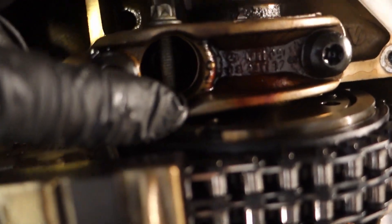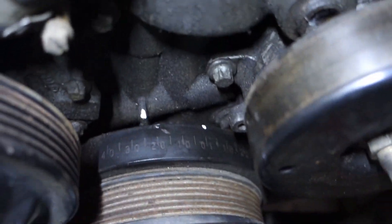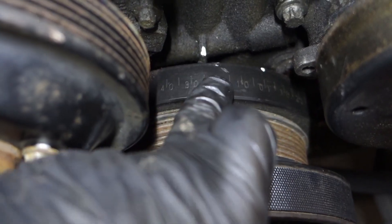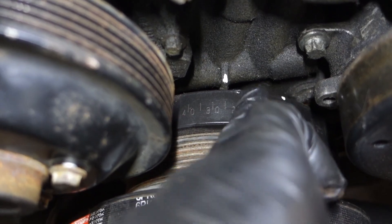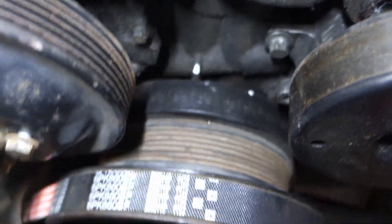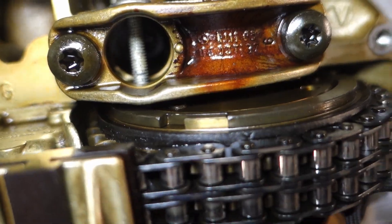As we can see, the camshaft is all the way retarded because this part is forward. Now we can see what crankshaft angle is — it's 25 degrees. That's completely fine; it can range from 20 to 30 degrees. If your timing chain and followers are new, you'll see something like 20 degrees. If they're old but in good condition, you'll see something like 25 degrees. But before reading these degrees, you have to make sure the camshaft is all the way retarded like here — otherwise you will see wrong degrees.